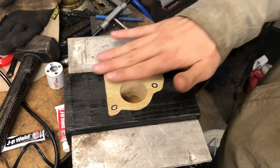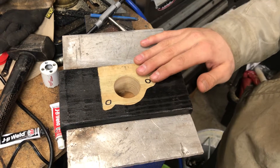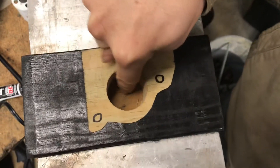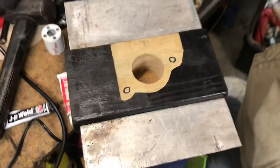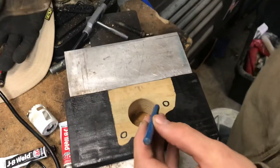This is the face — this is where your oil drain will actually bolt to from the turbo. What we need to do is punch through the interior to get to the inside of the pan. The best way to do it without taking it off is to take a center punch and find the middle the best you can.